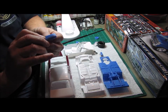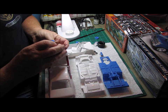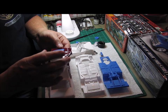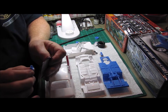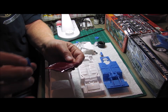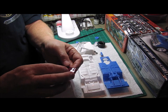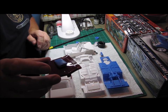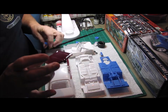I have the hood scoop from the Pro Street Nova, and I'm going to end up grafting that onto the Cutlass hood. There'll be a little bit of work — you can see how this hood has an indentation in the center and the scoop doesn't — so I'm going to have to either file the scoop so it'll sit in that, or use some cardstock to build that center recess up just a little bit so it'll sit there.